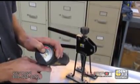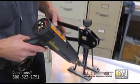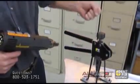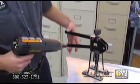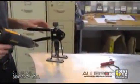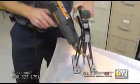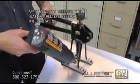So, the heat gun — we're going to go to 450 to 550 degrees and heat up the dent while we're pulling. You don't want to just grab the handle and close your hand. What you want to do is, you can actually almost do it with two fingers — you just want to easily squeeze on the levers. That will put a lot of force on the nail just because of the way the tool is built. It's kind of like working paintless dent repair. You can rotate the handle around or rotate the pulling tool around to get a little bit different pull angles on it.